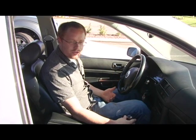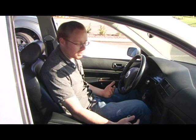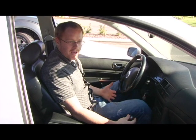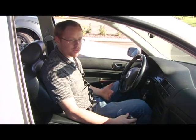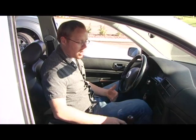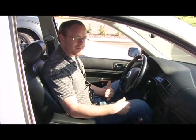On all underdrive gears, first through third in a 5-speed, the engine is spinning faster than the transmission actually is. So they're going to be underdriven. That allows you to get more torque, or get the vehicle going faster. In an overdrive situation, it allows the vehicle to not be over-revved while still going at a high rate of speed.